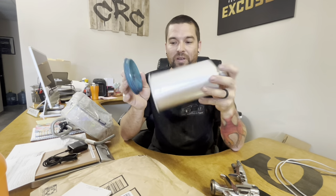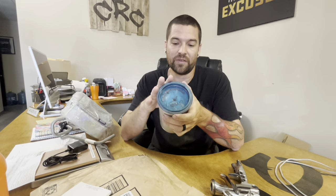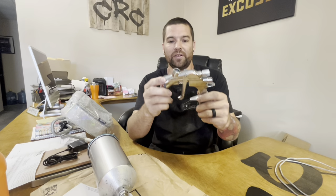The inside hole of the cap is very important. I use a toothpick to clean that out — that's what allows air to be sucked into your cap while you're painting, to keep paint flowing. Obviously you have to have air come in and paint come out. I've had issues where I skipped cleaning this out for a week or so. On my primer gun I'll skip cleaning that and then go to shoot primer and it's like blowing almost nothing out — because it's literally got a vacuum and the paint can't come out with suction. So when you're cleaning them, that hole is important.